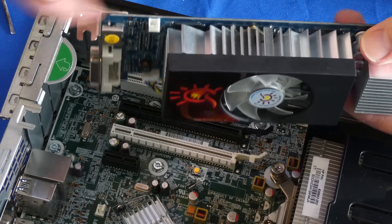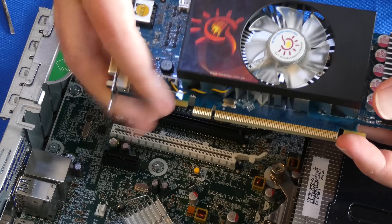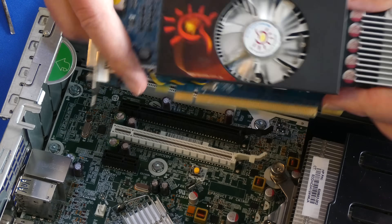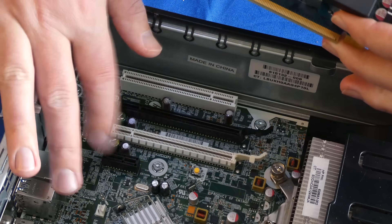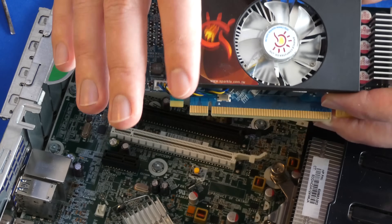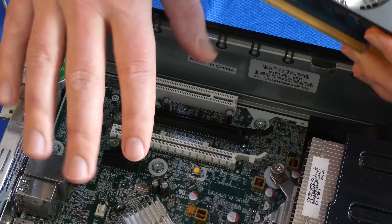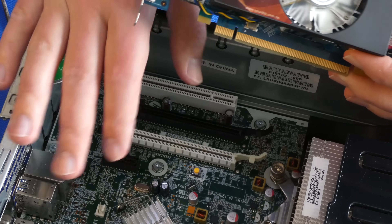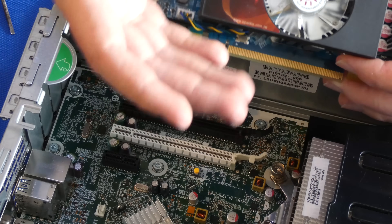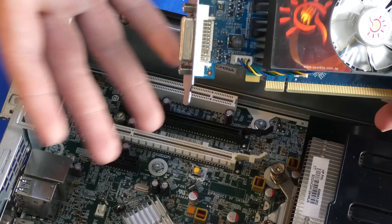The one I'm going to put in the description box below is probably the best one you can buy right now for low profile, and that would be the NVIDIA GTX 1050. They have a 1050 Ti version, but the GTX 1050 is probably one of the best ones you can get for this type of computer. This computer's power supply is rated at 240 watts, while those other video cards are rated at 300 watts. Most people actually have really good luck with it, and even if one of these power supplies goes out within a year, they're only around $30 to replace.